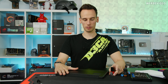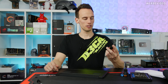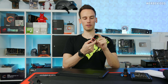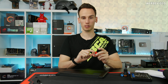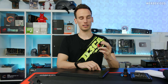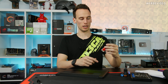The laptop is assembled again and we'll run a quick test to compare temperature and performance — there shouldn't be any difference versus before reapplying. One more word about TG Shield, the conformal coating: you can hear there's a ball inside to keep it mixed — make sure to shake it before use. This is a real conformal coating with no metal particles, unlike some nail polishes which can be conductive or capacitive. The operating temperature is much higher — it can sustain up to 110 degrees Celsius all day long, something normal nail polish cannot do.